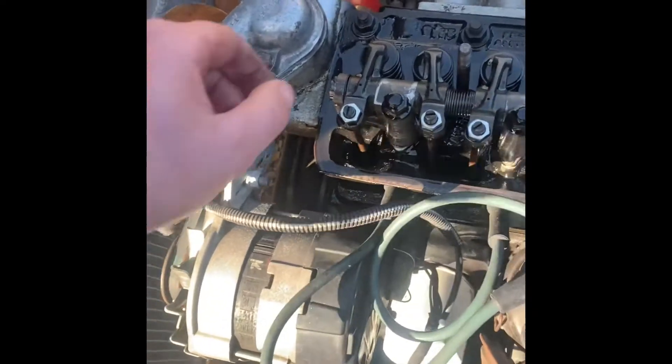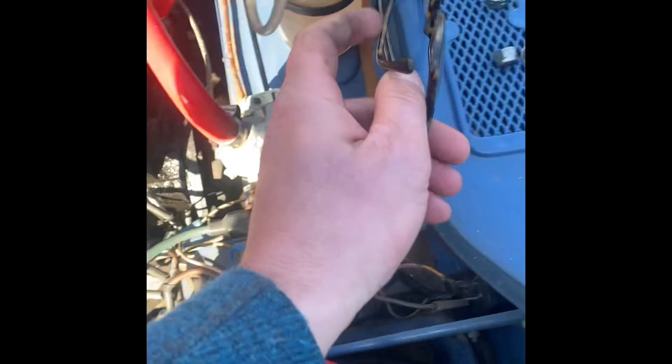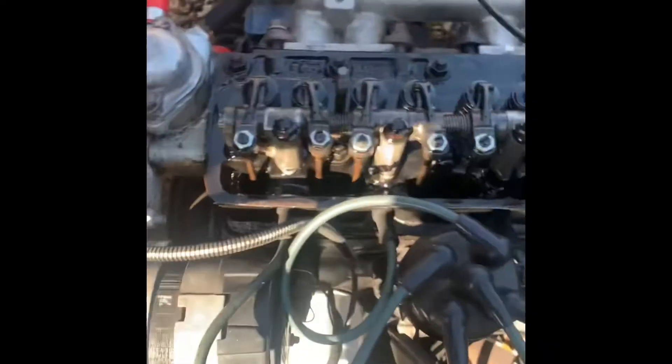You know it's fully up because it will get a bit of play. Also, it's quite a good time to see if your timing marks are lined up, because at the moment it is at the top dead centre. I'm just going to take these glasses off because they are winding me up a little bit, keep trying to fall off.